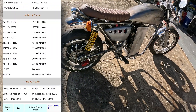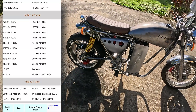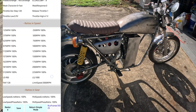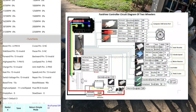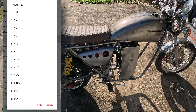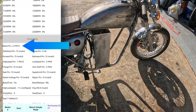For example, if you're on a motocross bike and jumping it, you try a triple, the front end drops, and you stab the throttle — that wheel is just going to run away. You need to set an RPM limit in ratios so you don't overspeed your wheel when it's unloaded in the air. Boost will do the same thing. Now for the boost pin: there's a chart online that makes you think it's pin six, but there are no pin sixes in the selections — there's pin 5, pin 8, pin 9. What I've been told is it's actually selection six, pin 14, that's the correct selection for the boost pin to go to the brown wire.